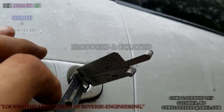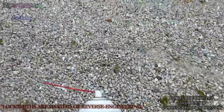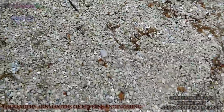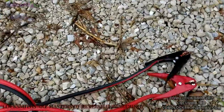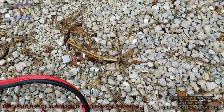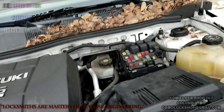So I picked it unlocked again. It was actually a lot easier to pick counterclockwise, and I had to input several different progressions, kind of guessing, because I was getting variations between clockwise and counterclockwise readings. So I went ahead and put in half cuts, and that did the job. And so I cut a metal test key, and it turned the ignition, but the ignition is currently got a hold of my key and won't let go.